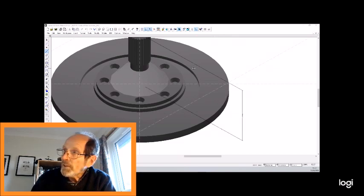this is a 3D model, and the outer part represents the 2CV friction plate. Then there's a spacer, and then there's the original Austin 7 first motion shaft drive pinion. Now there are several mods that have to be done here quite carefully.